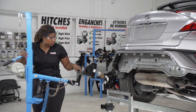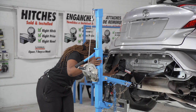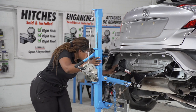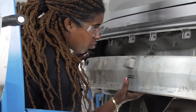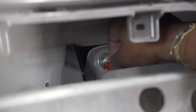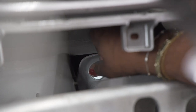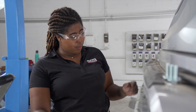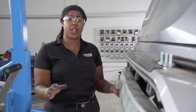Now we are going to align our hitch with our bumper using our U-Haul exclusive hitch jack. If you do not have a jack, I definitely recommend getting an extra set of hands. To attach our hitch, we're going to be using our provided bolts, which include the bolt, the lock washer, and the flat washer. Now we're going to align our bumper beam with our hitch and our bumper. Even with U-Haul's hitch jack, this was difficult to line up the holes by myself, so if you do have an extra set of hands, I highly recommend using them.